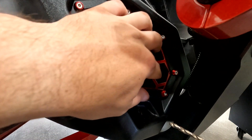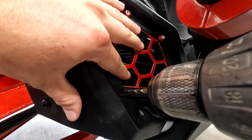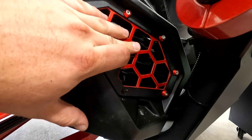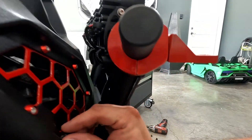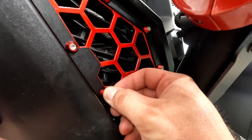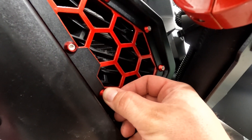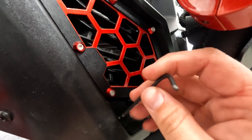Use a 3/16 drill bit, make sure everything is lined up, and drill exactly where the bolt goes into the grille. Make sure you don't drill too deep — there is nothing behind that spot. As soon as you break through you should be good. On this side, make sure you don't go deeper so you don't hit anything. Use the shorter bolt from the hardware, put your washer through going straight, then put the washer and nut from the back. Use your socket wrench from the back and an allen key from the front.